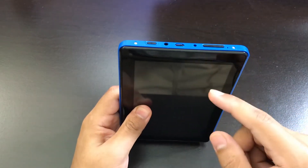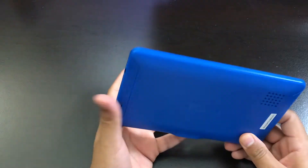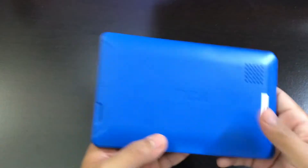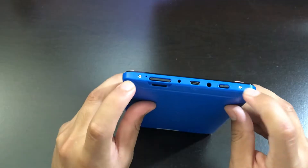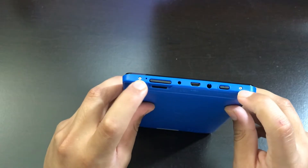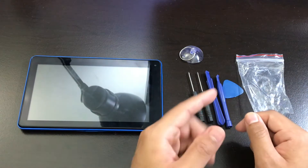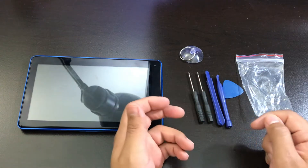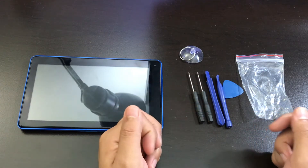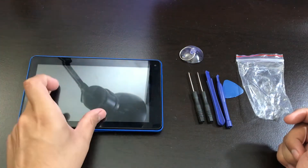If this solution did not work for you, the next thing you want to do is disconnect the battery. For this it's pretty easy. For other tablets there might be two screws on the bottom, but for this tablet specifically there are two Phillips screws on the side of the tablet that I'm going to take off. I have my simple tools right here — all of this costs like 50 cents to a dollar on eBay, very inexpensive. These are for the iPhone but you can also use these tools for your tablet.